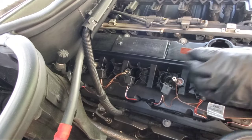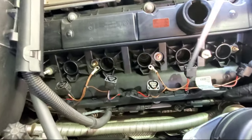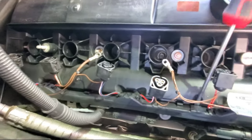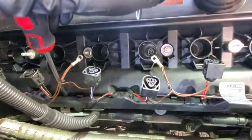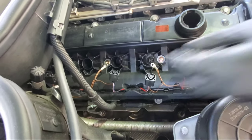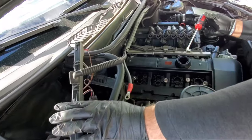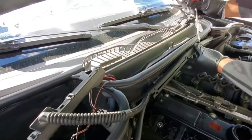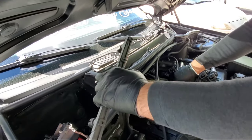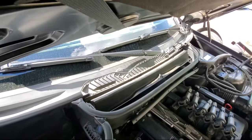After removing the two bolts, the wiring harness for the ignition coils is released. Take a flathead and pry up under there, then go along and lift it up in a few spots. Put the wiring harness to the side. Then take a flathead and pull off the little cover here, which will allow you to move the cords over to the side and out of the way.